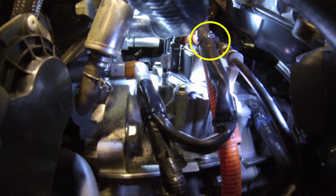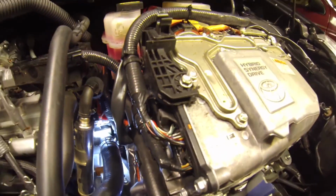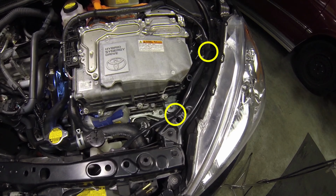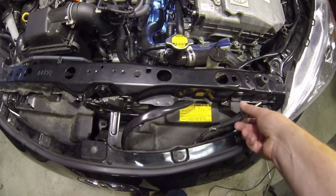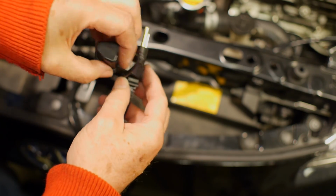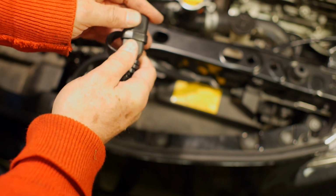This tie wrap is the last anchor point on the engine. This loop provides the slack for engine movement, and the rest of the tie wraps are to fixed points in the engine compartment. I left the cable end loose in the tray above the radiator. So the last thing we need to do is to loop the plug cover onto the plug. And we're done.